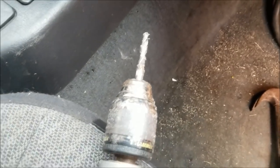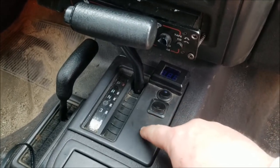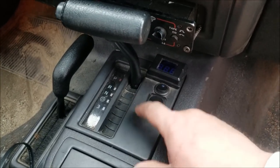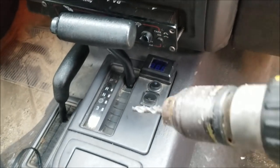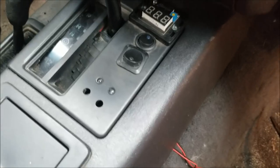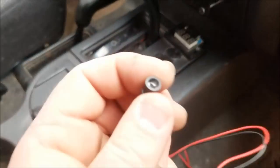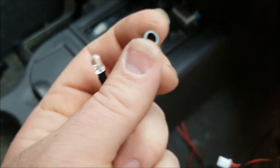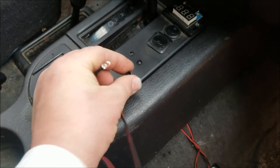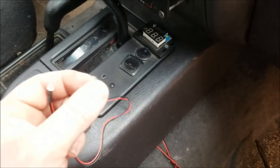So we got our quarter-inch drill bit here. We'll find a suitable location — I have my remote switches to turn on my amps right here, so I'm probably gonna go ahead and just drill this area for power LED, clipping, power LED, clipping — both amps. I'm gonna get that drilled up and check back. So you can see I have the two power LEDs ran through and installed into the RPCMs. I'll tuck those up underneath the console. When you get your holes drilled, the black trim rings pop off the end — it is kind of hard to do with one hand — but they do pop off. Go ahead and get your quarter-inch holes drilled, pop these into place, run the LED up, pop it back in, and then just make your connections.